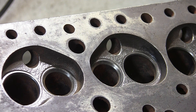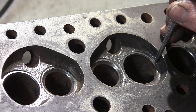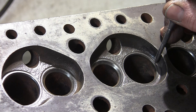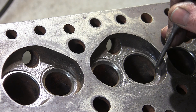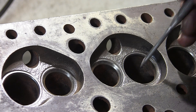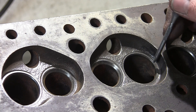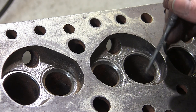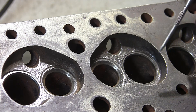We will actually be putting bigger valves in this cylinder head. One of the main reasons for putting bigger valves in the inlet — not only an increase in airflow, but because of the width of the seats. The factory seats are ridiculously narrow, around about 50–60 thou, very narrow, so they do actually wear quite badly. So we're going to have to put a bigger valve in, basically so we can cut a fresh seat. If you use a stock size valve again and you cut that seat, the valve's going to start to recess into the head, so we'll go up a valve size. We'll actually be able to reclaim the seat and cut a multi-angle seat in there, so that'll help airflow, and obviously we can cut the seat a bit wider, which is a lot more suited to road use.